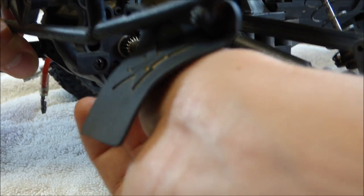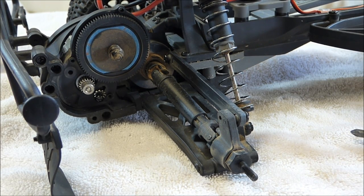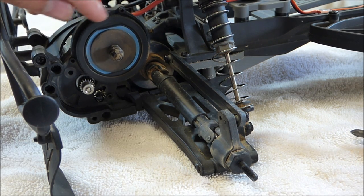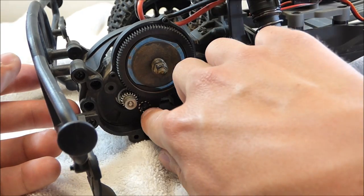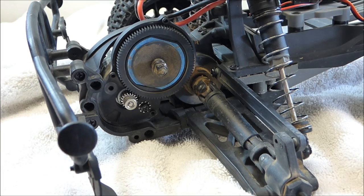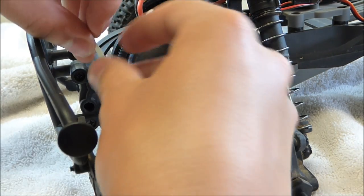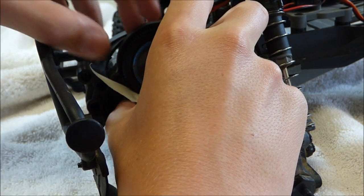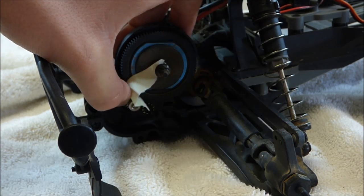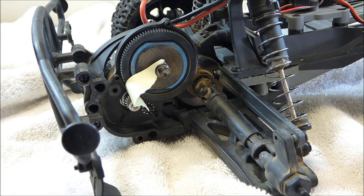I just like to take this screw right here and stick it in and screw it down — but when you put this screw in first, just leave it a little bit loose. That way you can actually move the motor to bring the pinion gear closer to the spur gear when you put your piece of paper in there. I'm going to take this post-it note, rip a small chunk off, and stick it right here, feeding it in between the spur gear and the pinion gear. Then I'm just going to push the two together. That right there should be your ideal gear mesh. With a piece of paper in between them and the two pushed together, you can then take your other screw and screw it in.